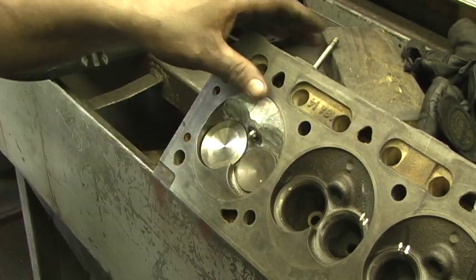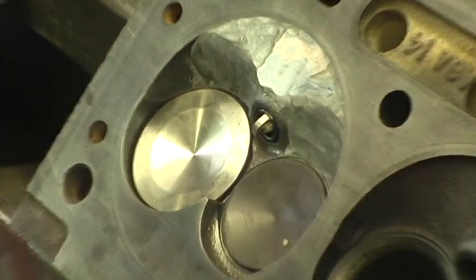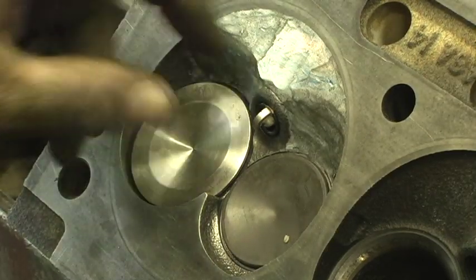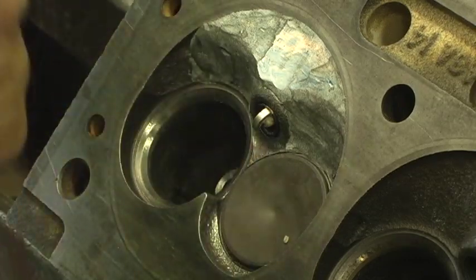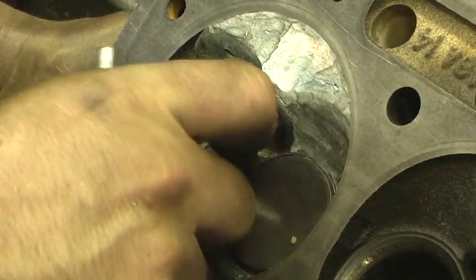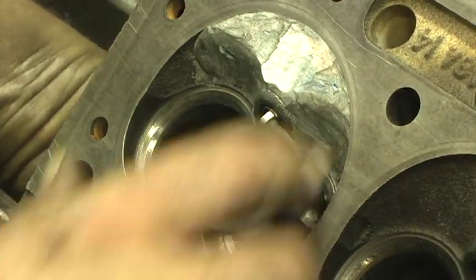If you just were to put that valve in there and not go in here, cut all this out, alleviate it, change the chamber shape, and do all the stuff that makes it work — it will actually slow you down. Because as the valve gets closer to the wall, it cuts all the airflow off; no air would get around it. Whereas with this valve, there's actually room for the air to come around it. So sometimes the quickest way to hurt the motor is to put in bigger valves unless you're going to go in there and rework the combustion chamber.